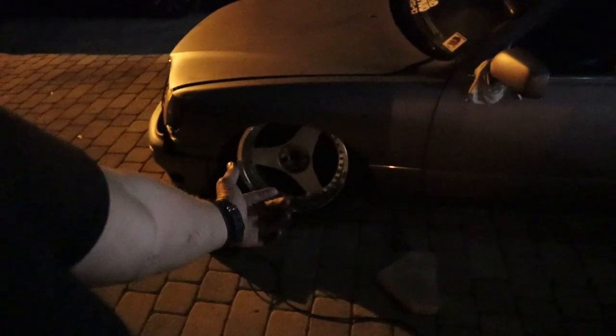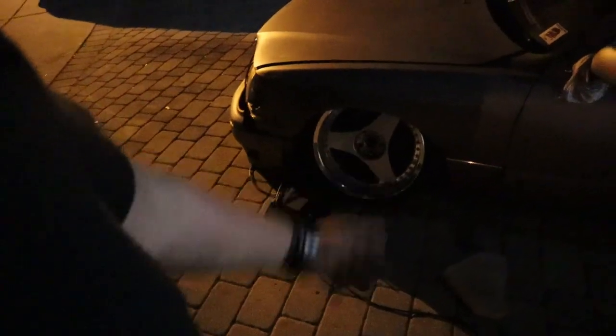Quick update — it's one in the morning. Just dropped Brian off. Been grinding on the LS the entire day. Just got some tires mounted. I am drained, feeling weird, so tired, and I work in the morning. We got new tires on the Volgards, but although they're 255/40s they seem a bit beefy — I might have to space the fender out a little bit. They fit in the rear, but in the front I think they're going to rub even just driving straight, so I'll have to deal with that tomorrow after work. Not going to end the vlog here — I'll finish it up tomorrow after work, then it's packing time, loading up the trailers and heading out.